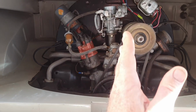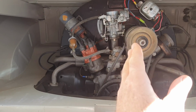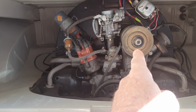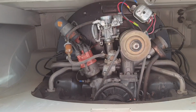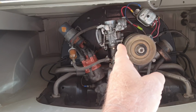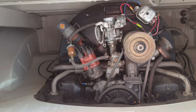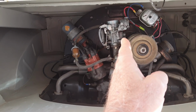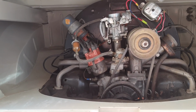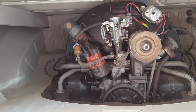Okay, remember, if you notice, this is leaning a little bit. This was a 6-volt car originally, and the generator is smaller on those. And this is a later model carburetor. So the early carburetors had more room in there, and you could actually just go right to 12 volts on them, no issues. But if you put the later model carburetor on it, a lot of times they have stuff that sticks out a little bit, so a lot of guys bent the intake manifolds to make them fit. I don't think this one needs to be bent, but I've seen it before.